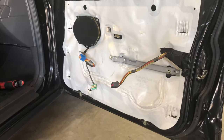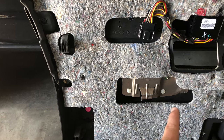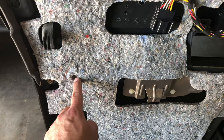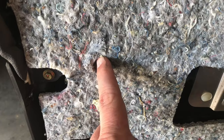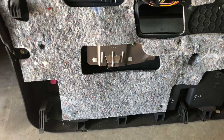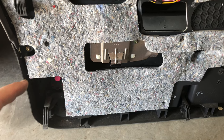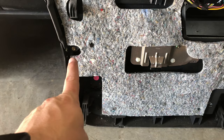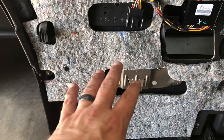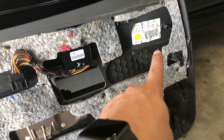For now I'm not going to change the speakers, so that'll stay in there. This is the back side of the panel and the area we're interested in is right in here behind that bracket — that is where the armrest is. You have to move this insulation aside and you can see right there is one of the plastic welds that holds that insulation in place. There's another one up here. Basically they take a really large soldering iron or something with a hot tip and melt that insulation into the plastic. This screw right here is one we'll need to take loose, and the one behind the metal bracket is another. Once we get the insulation and screws out of the way, you'll see the tabs we're going to have to melt.